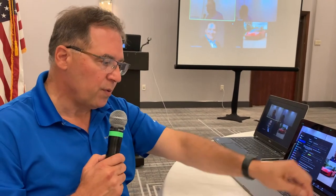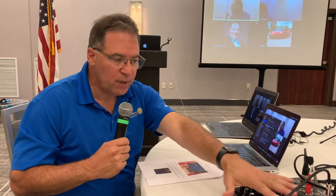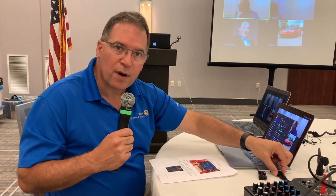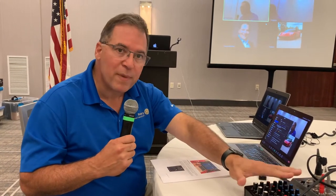The microphone is running through the room and through Zoom. All the sound from Zoom is coming through the microphone in. It's integrated, and we have everyone together in one meeting simply because we added a mixer, several cables, and a USB sound interface card to the equipment you already have. This is what makes it possible.